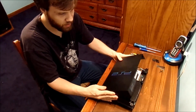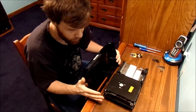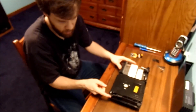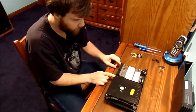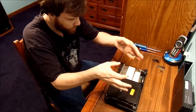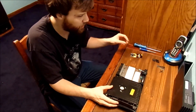Now, when you take this off, be very careful, because sometimes you may have your switch and the eject tool here attached to the cover. First of all, we need to take out this screw and this screw, and this whole piece will come off, and we put the casing shell off to the side.